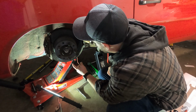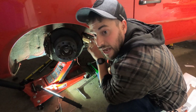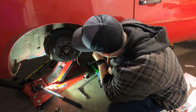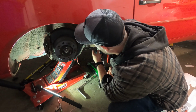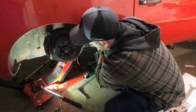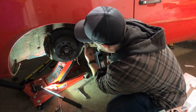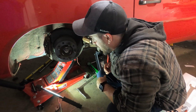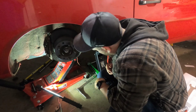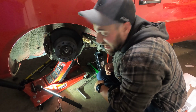So what I did was I put basically the whole trailing arm back in, bolted the entire hub back on, everything outside of the brake line. And then I jacked from under the brake hub and used a piece of wood that I intentionally crushed to push the mount horizontally. Even though it's bolted in, there's a lot of play in the rubber bearing, a little bit in the mount itself. And then you're basically just doing what you can to get the bolts back up into the body. It's a nightmare. Took me an hour per bolt for those 2 bolts and probably an hour per bolt on each side for the body mounts. So I still have to go do the other side for these 2. Real pain in the ass.